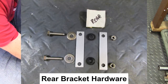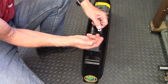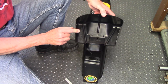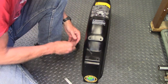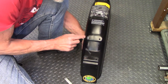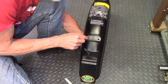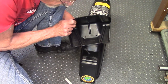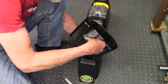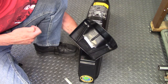The rear of the fender mounts using the same method — a flat plate under the fender and then the hex bolt and flat washer. However, the hex bolt is longer on the rear than the front because it also mounts the tool box. When the bolt comes through the fender, just like on the front, there's a rubber grommet that goes against the fender and the underside of the frame bracket. It then goes through the box, and inside the box is another metal plate with a lock nut. That's how the rear fender bracket works.